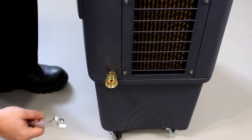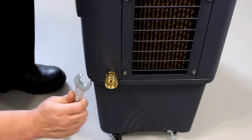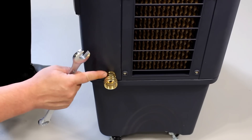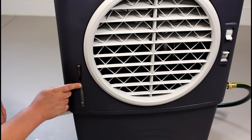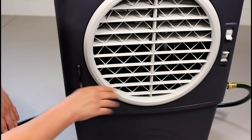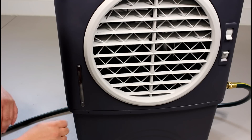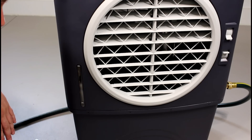When you're putting the water hose adapter on, take your time and make sure you've got the threads right. Hand tighten it and then just half a turn with a wrench. There are plastic threads in here — you don't want to put it on too tight and strip them. Just turned on the water; the gauge is slowly going up. If you have high water pressure where you live, just gently barely turn the tap on. There's a valve in here that will open and close as water is needed, so you won't have to worry about any type of overflowing or it running dry.